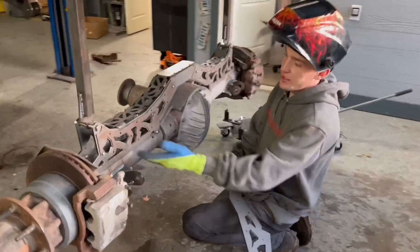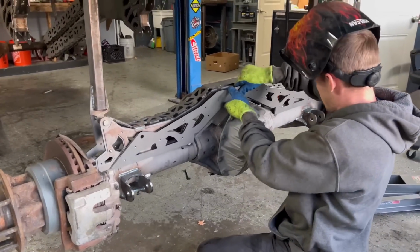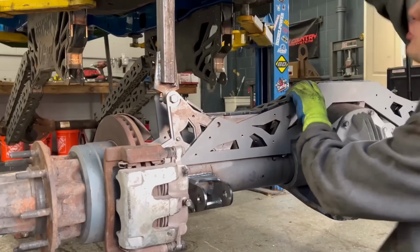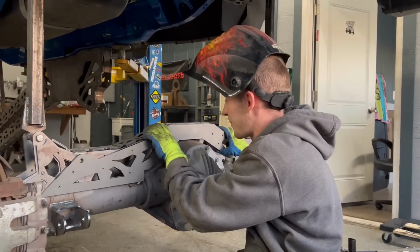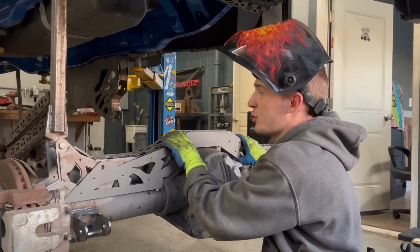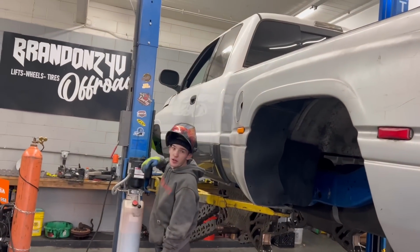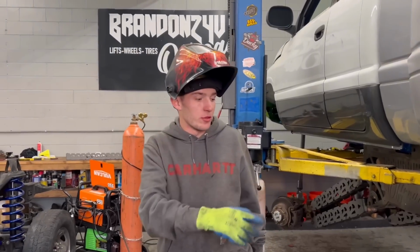As y'all see, coilovers mount here and here, and now with the new truss, they will mount in a whole different location. That gives me plenty of clearance, and now the shock will bolt in at the bottom of the frame. The reason being is because it's like a monster truck. You guys don't understand how big this truck actually is. And right here is a little bit lower than ride height. It's huge. So let's go with these arms and take the plasma cutter to that rear truss and get the thing out of here.